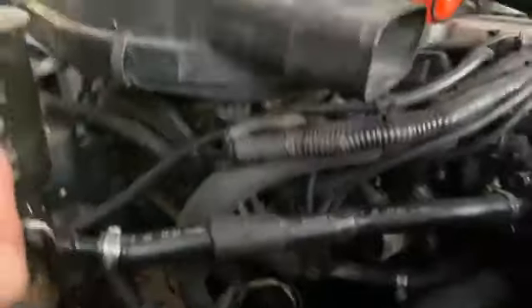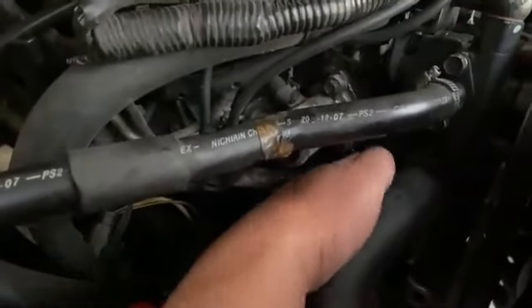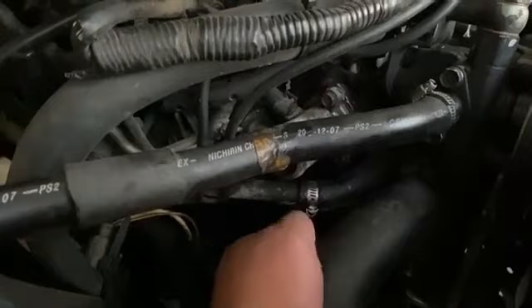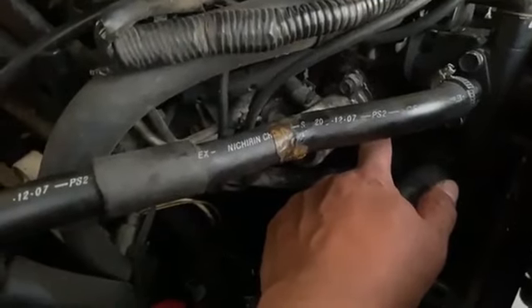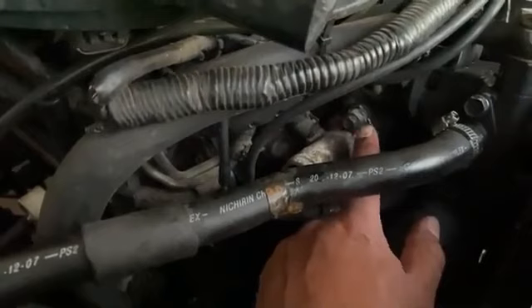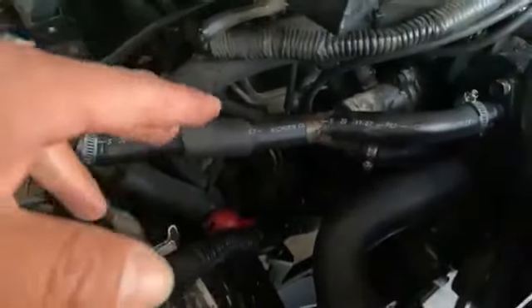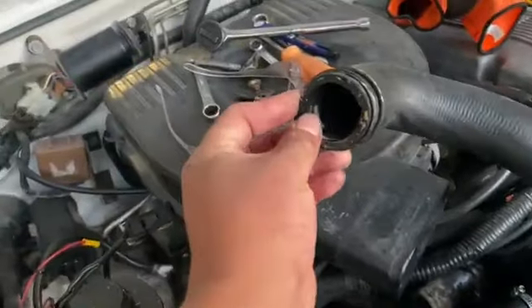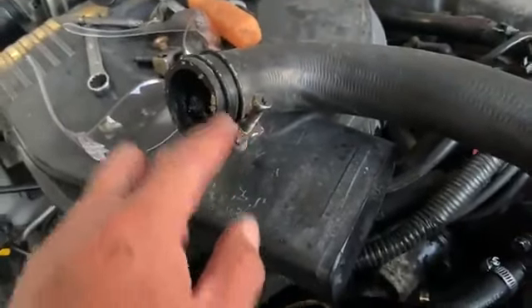There is another hose back here that is a little kinked — there's a hose where my finger is. It's a little kinked. I replaced this in the past, so what I'll do is pull it off and trim it just a little. I got a new gasket for this — I'll pull this off the housing, use some gasket seal, some loctite, get a new hose, and I'm definitely going to replace these factory clamps, and do that for the bottom as well.